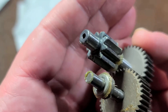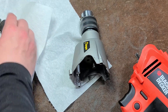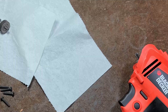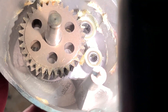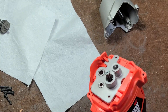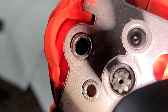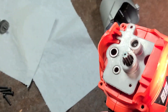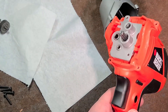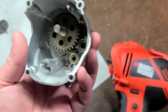We can see how coarse that final output gear is. Lighting it up, we have needle bearings on those idler gears, which is a big improvement over the old versions. It's just a sleeve bearing for the main spindle, and down there we can see a needle bearing on the front of the motor. So like the newer one, it was mostly ball and needle bearing — fairly impressive.